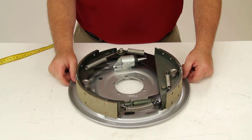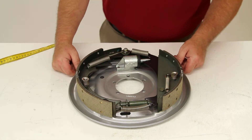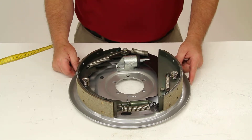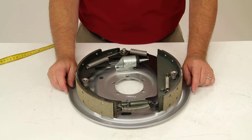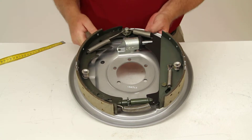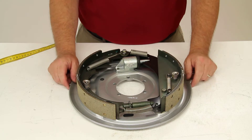Briefly on the free backing system — what that means is it will let your trailer move in reverse without actuating the brakes. When you begin backing up, the brake shoes are firm against the drum as in any braking situation. And as you continue in reverse, the shoes will turn with the drum until the lining pressure is released and you are able to back up freely.